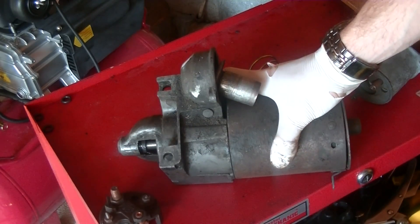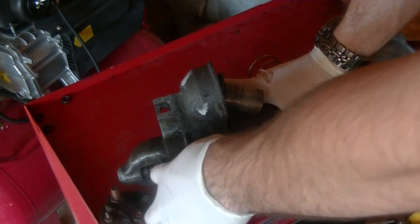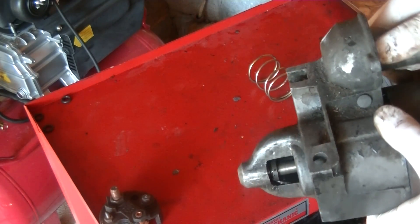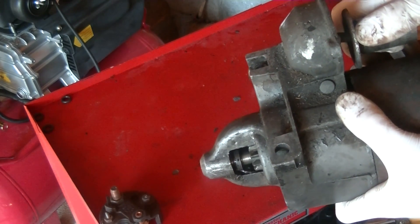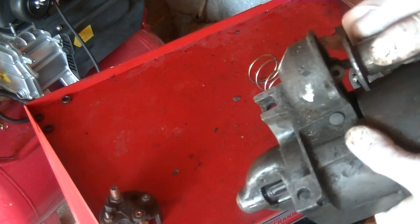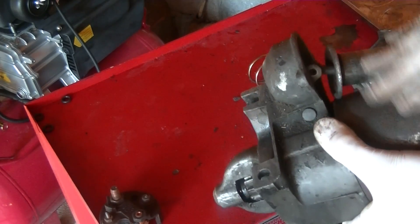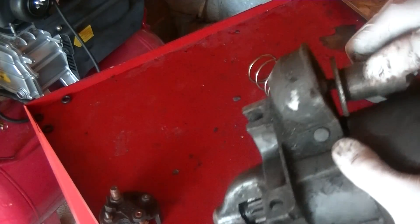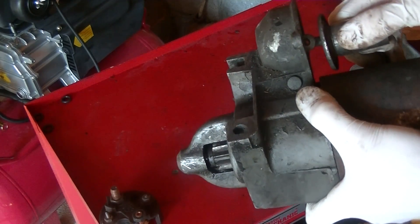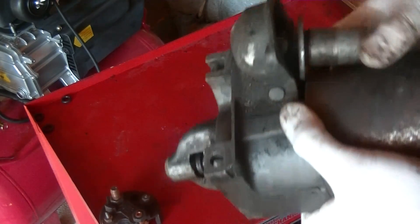This is in slow motion — it pulls back, the gear engages, and when it touches the chassis right there, it will ground itself, and now all of a sudden the starter motor has power. So it doesn't actually start the starter until these teeth are engaged and it grounds. When that happens, it engages the motor.